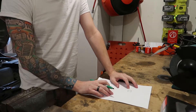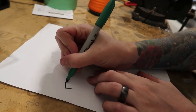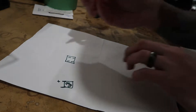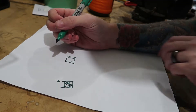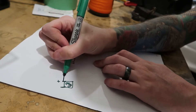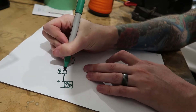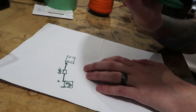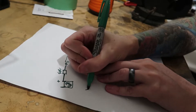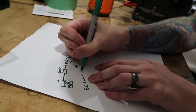First I'll draw a diagram of how to wire it up. The relay has four prongs on it. For the battery wire, I'm using six millimeter cabling - probably a little too big, four mil would work. I've got two meters of red six millimeter wire. We want a fuse on that wire, and it runs to pin 30 on the relay. If you flip the relay upside down the numbers are written on it. The ECU signal wire goes straight to pin 85 on the relay.